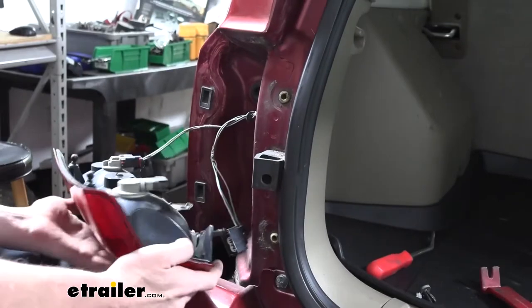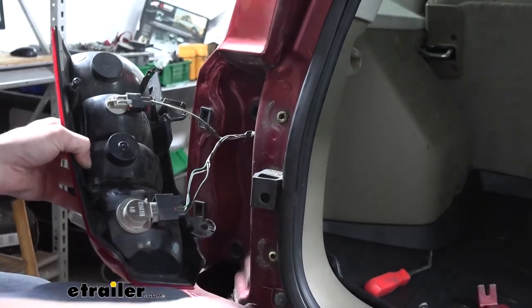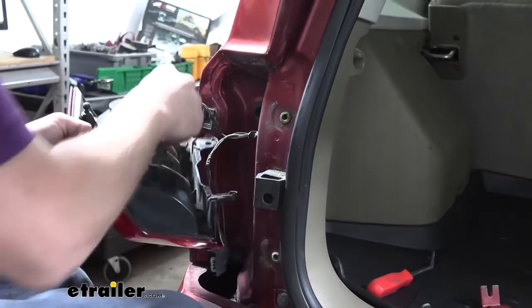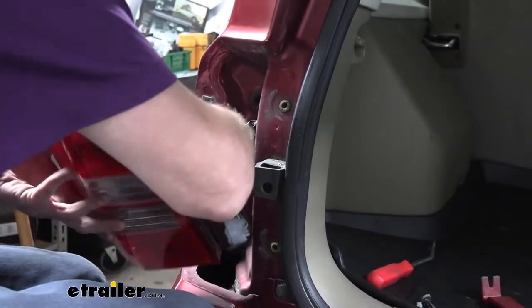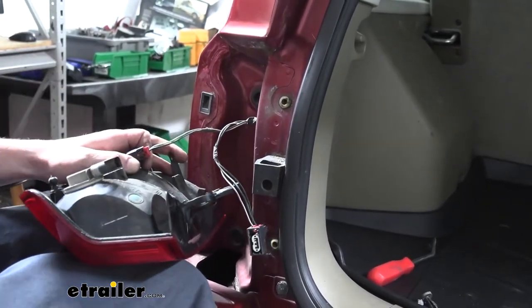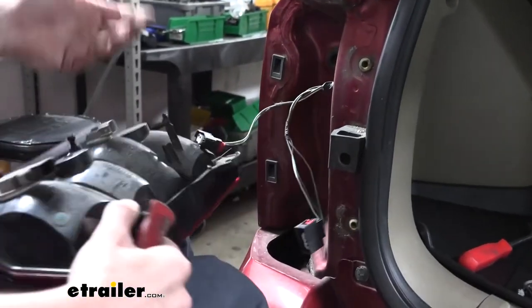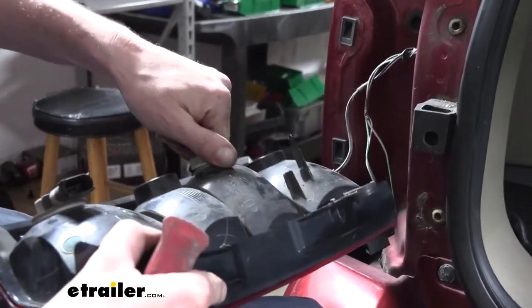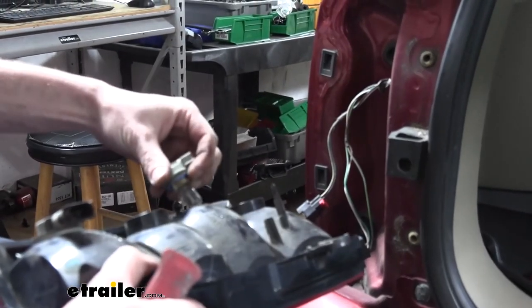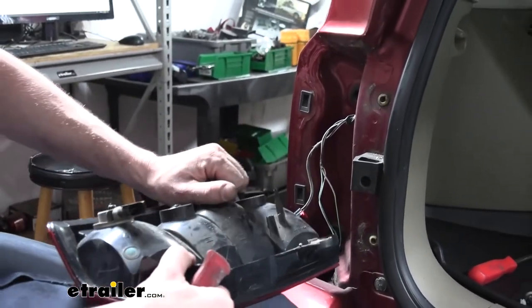Once we get that to pop out, we've got a couple of electrical connectors on there. You'll push back on the lock tab, press the button, and that'll slide out of there. Same with the other one — push back on the lock tab. Sometimes the dirt and debris in there makes it difficult, so you might need to use your screwdriver to push back on it, then press the release tab and disconnect it. You also have the option, instead of disconnecting the connectors, to twist the bulb and slide the bulb out. But I recommend leaving the bulbs in — that way you don't accidentally damage them. If you are struggling really hard with the connectors, that's your other option.